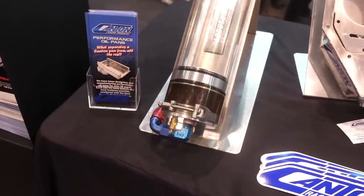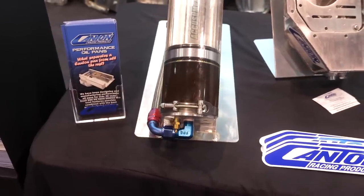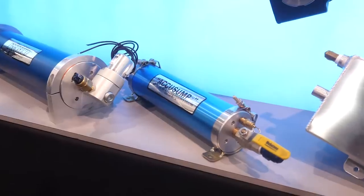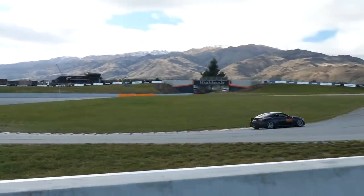Let's talk about how the system operates. It acts as an oil accumulator, so it fills during operation with engine oil under normal oil pressure. Yes, it does fill under normal oil pressure and acts as a buffer when you're using a wet sump system. When you get oil pan cavitation due to heavy slosh from pulling Gs, or windage that foams up the oil causing a pressure drop, the AccuSump will dump oil and pressure back into the oiling system so the pan can recover and the bearings and engine are protected with an adequate amount of oil.